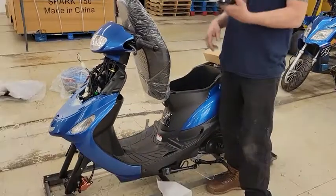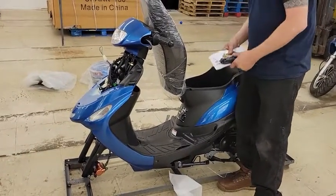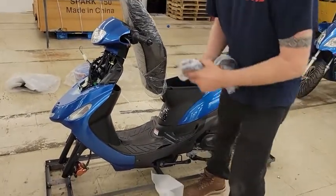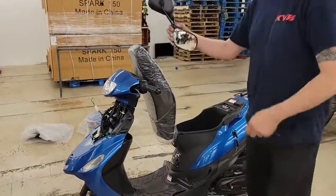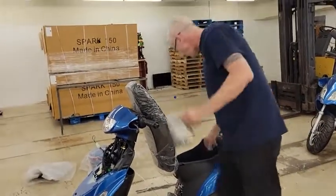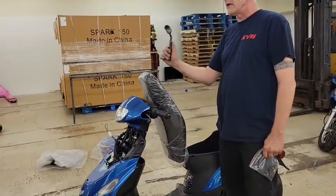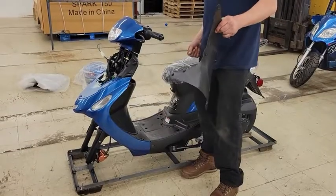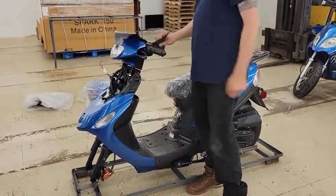You should probably find a pot — we have several spare at this moment. Unwrap carefully and set them to the side. You have hardware and a lever that goes on your center stand that helps you actually put the bike up on the center stand. In the past these vehicles have come with the battery underneath the seat and it needs to be assembled, charged, and put back in the bike.